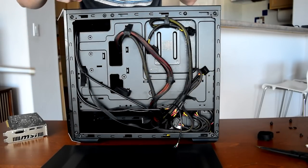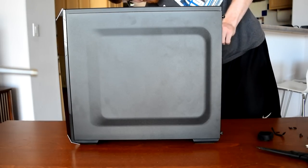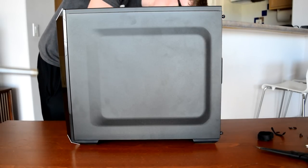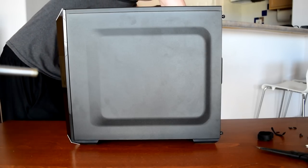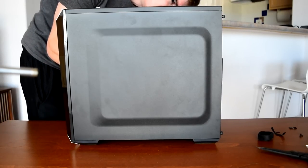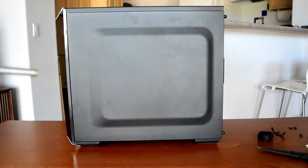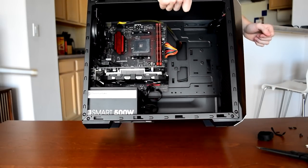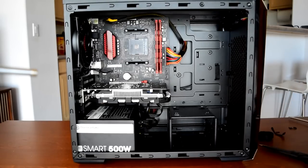I'll drop a link where you can get those in the description below. Unfortunately, my camera stopped recording right before I put the side panel back on, but rest assured I got it back on without the use of vise grips or a hammer. After attempting to tidy up all these cables, I have developed an extreme appreciation for modular power supplies. If you're doing a budget build like this one though, the money saved with a non-modular power supply is more important than the couple extra minutes you'll spend routing the cables. With the side panel on and the cables all in place, I think it came out pretty well. I put the hard drive cage back in, which just takes a few screws, and the build was complete.